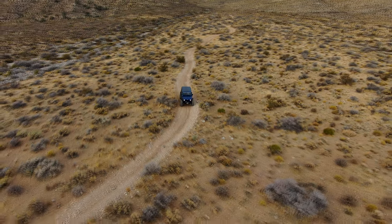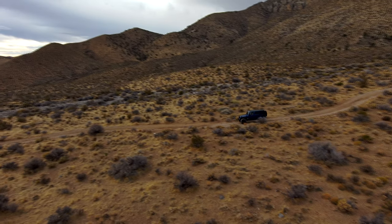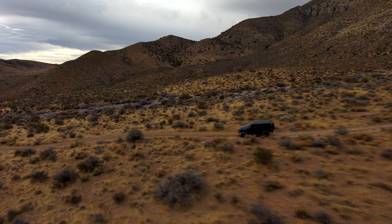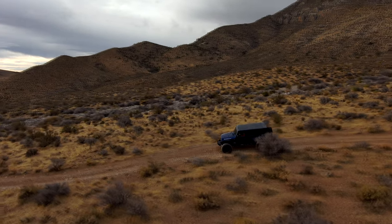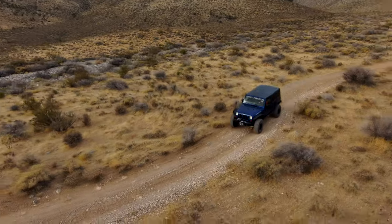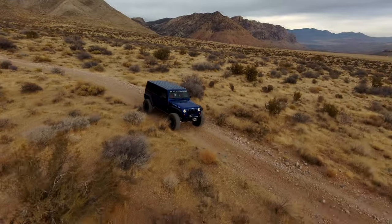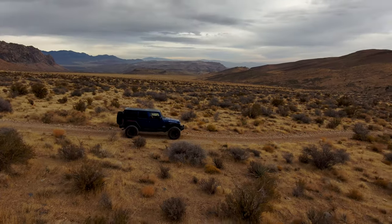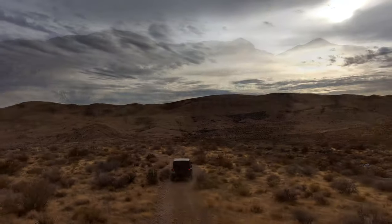Now, one of the advantages of this setup is that if the Chrysler side does go down, like you melt a TIPM, the GM side may continue to run, and I've had that happen. But I will say, back in the day when we were doing analog digital, we ran the fuel pump and starter circuits and all that directly through the GM side. We hardwired it. We're not doing that anymore with a single module, so we are more reliant on the Chrysler side. So let's talk about what really inspired me to do this.